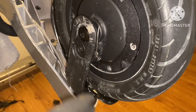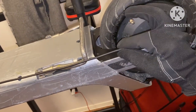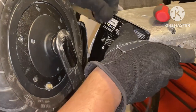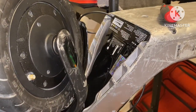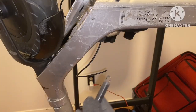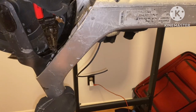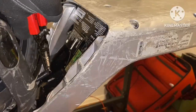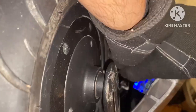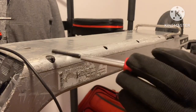We'll leave that alone for now and make adjustments later. Go ahead and get our tabs on our sides and get our scooter flipped over. Stretch out my cable — it's perfect now. Let's go ahead and put this cover on and get this battery open. Loop the spring up this way — grab this end with my little pliers. Right up top just loop this over this clip. Now we're going to remove our T40 screws.